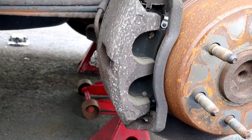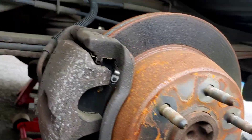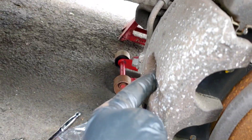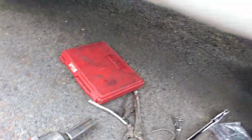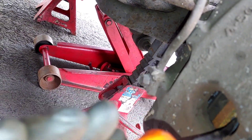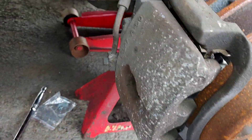I'm going to try to show this with as few jump cuts as possible. On the back here, I'm going to put a small pry bar in and push — just make sure I'm not pressing against the pad. This is the rotor and that's part of the caliper. I just want to compress the piston just enough so it's moving a little.